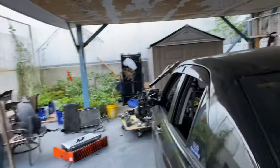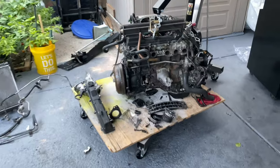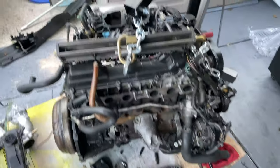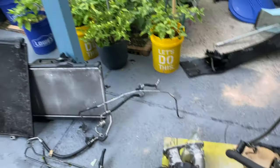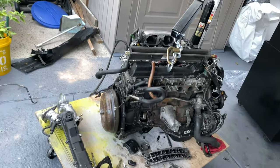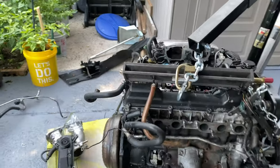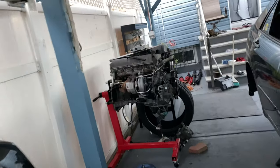The clutch you're going to need is off of a 2J. So when you're buying a clutch, make sure you get a 2JZ-GE clutch kit. You're going to want the flywheel, the clutch, the pressure plate, and some of them do come with throw-out bearings. I will be going with a stage 3 clutch out of a 2JZ-GE. Basically type in '2JZ-GE clutch kit' — I'm going to go with probably an XTD stage 3 clutch because I plan on pushing some power with the 1J. For now it's not turbo, but there's always upgrades for the future, so I don't want to be pulling that trans out again.